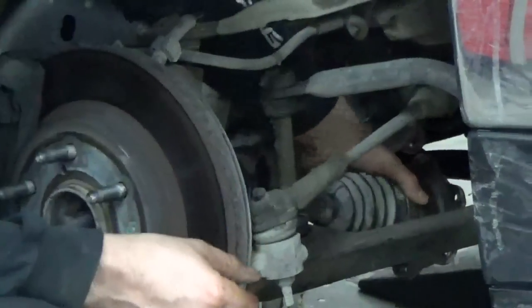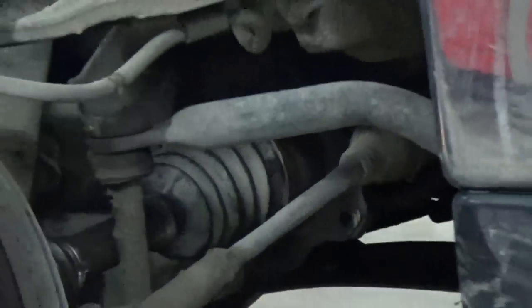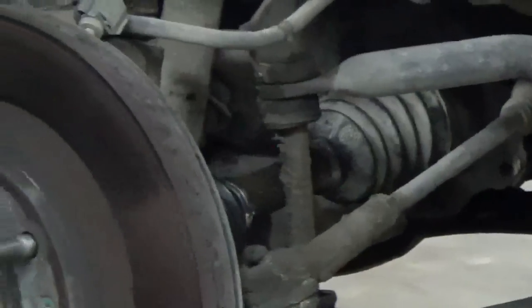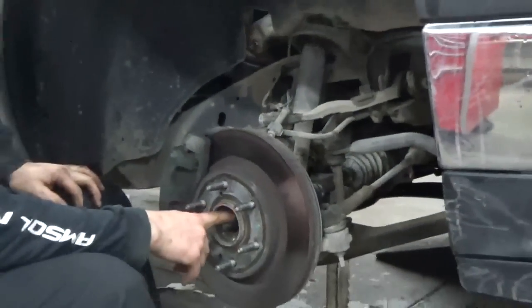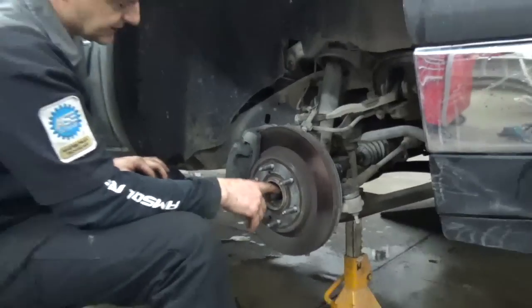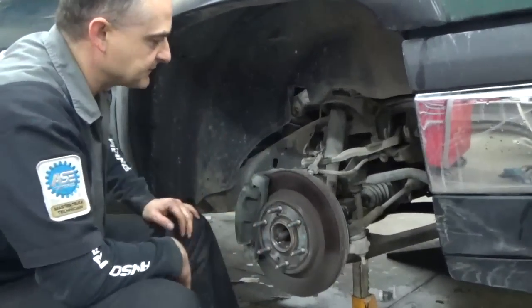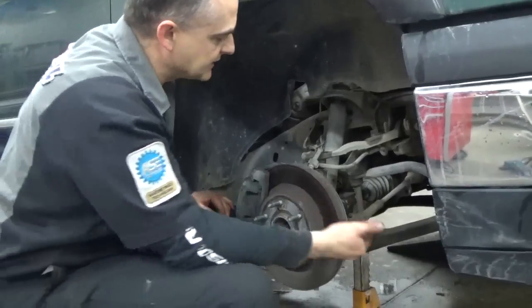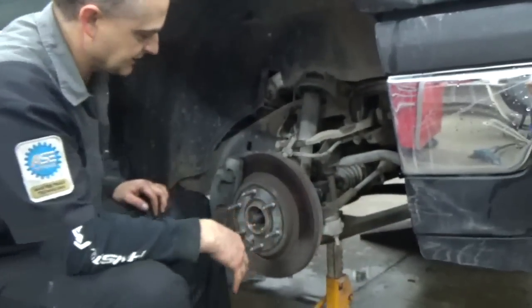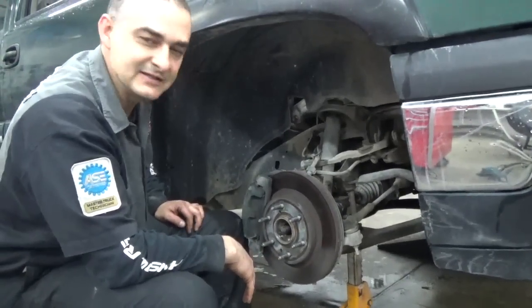And then we can bring the flange up, and what we'll do is finish putting those bolts in. I'll usually put a little bit of Loctite on those, removable Loctite, just to make sure they stay snug. Then we'll put the washer nut on here, torque those down, put the cap on, and that's it for this job. So it's not that hard on these Chevys. Some of them you have to take the A-frame loose to get them out, like on some of the cars and that, but this Chevy truck's fairly easy, so don't be afraid to tackle this one.